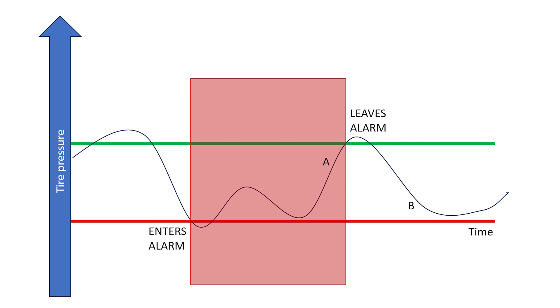You may also see the situation where one tire is alarmed but it's at the same pressure as the others. This is because the tire pressure monitoring system follows what is called a hysteresis loop — as a tire pressure drops and passes an alarm threshold, it will go into the alarm state, and it won't clear until it's reached a much higher pressure. As shown on the chart, point A is still in an alarm state even though it's at a higher pressure than point B, because it hasn't re-entered and exited the alarm state. Each tire alarms individually, so it can look odd if one tire has been in sunshine and entered an alarm state, as it may be warmer and have a higher pressure than another tire with a lower pressure that has never been in an alarm state.